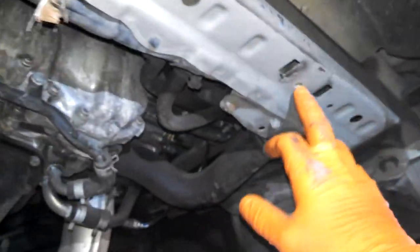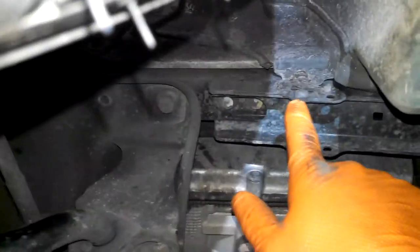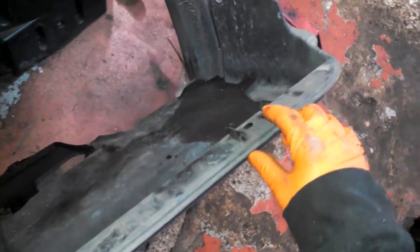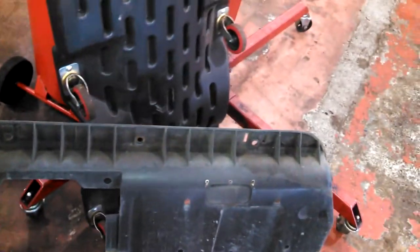So there's a cover here. There are some 12 millimeter bolts along the edge here, two back here, and then there's one up here as well. A 10 millimeter bolt on this side, and a 10 millimeter bolt on this side. I've already taken the shield off. It seems to be missing some pieces. It has little fingers here, so it won't really fall on you. You may not have all these pieces here, but that's basically it